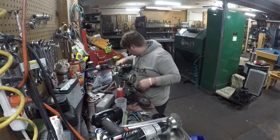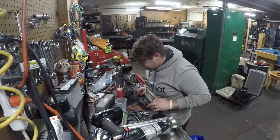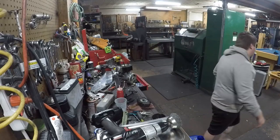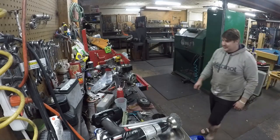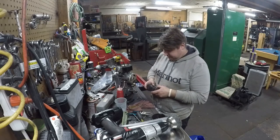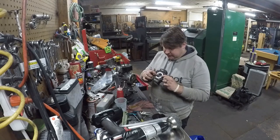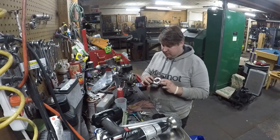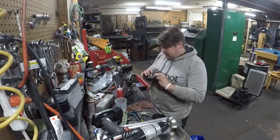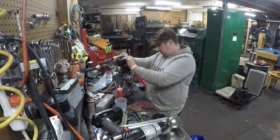Where did I put the stock head gasket? Not reusing it. I just want to remind myself of something. Gotta go get the new one. See how that fits in there? If you run these without a head gasket, to try and get more compression, they will not run. You'll hear the air just rushing out. It's kind of like lock it in. I don't know if the casting is poor or what, but...